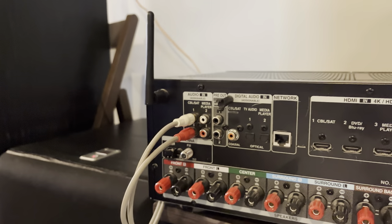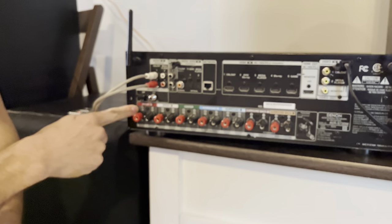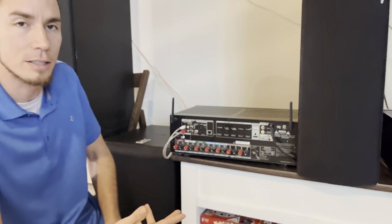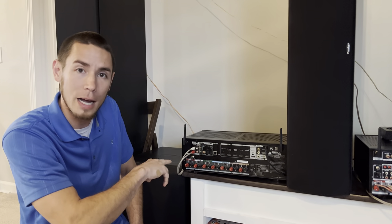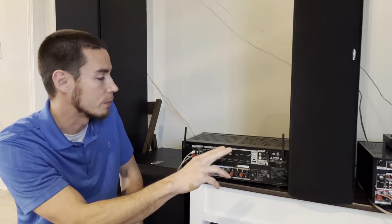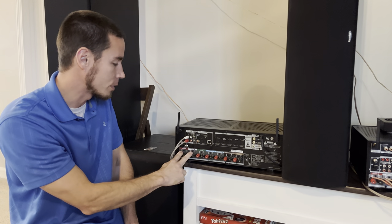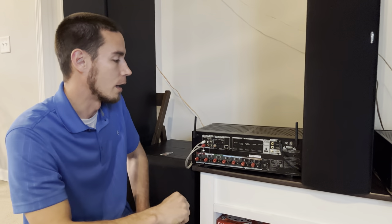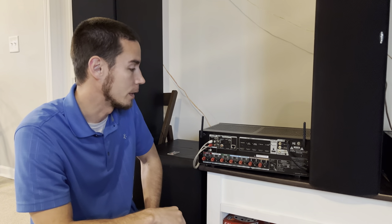What's missing here due to the temporary setup are the speaker cables. What you would do from here is run your front left and right channels out and run speaker cable from this receiver to the two speakers you're adding for those last two height channels — or whatever two pre-outs you decide to use. Note that whatever two channels you use for the pre-outs, you wouldn't have those hooked up as speaker outputs on the larger receiver. In my setup, the front left and right outputs of the S720 go to the rear ceiling Atmos speakers — the height two channels.